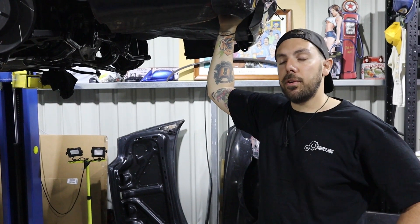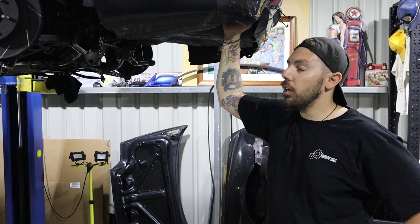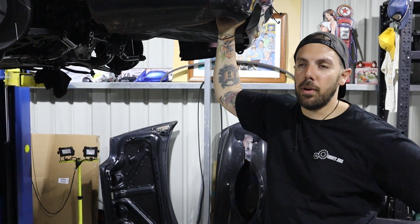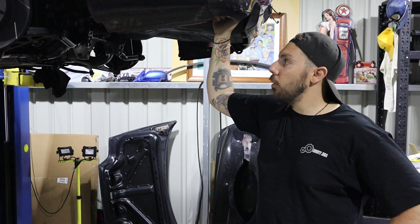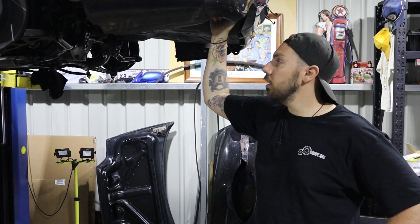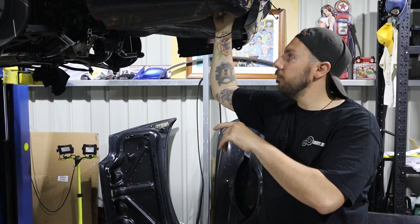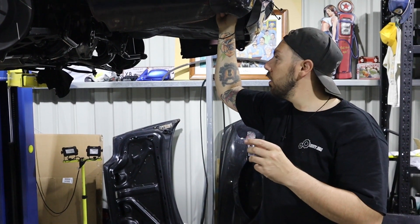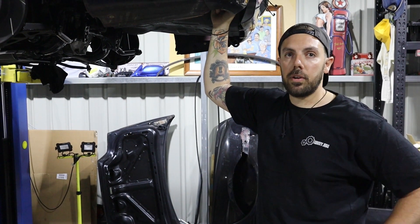Next day on the rear end of the 33 — we are going to put in the drive shafts today. I had to get them sent away and refurbished a bit because the boots were a bit dry and crackly. We'll put them in now and attach them to the diff that we put in yesterday. We've already got one side in — we'll take you through how to do it. This is with all the arms still connected and the diff in, so we'll maneuver it and show you how it all goes together.